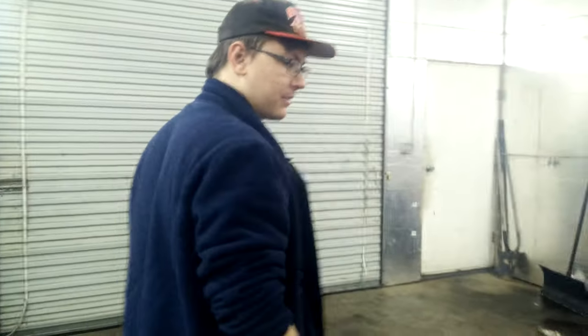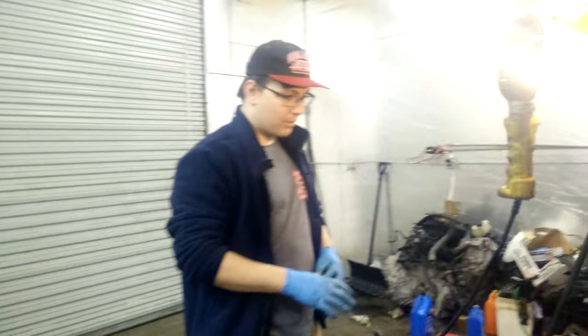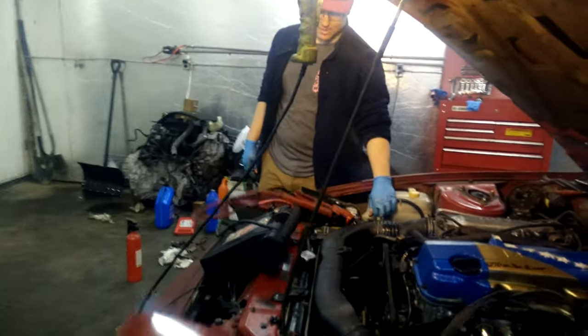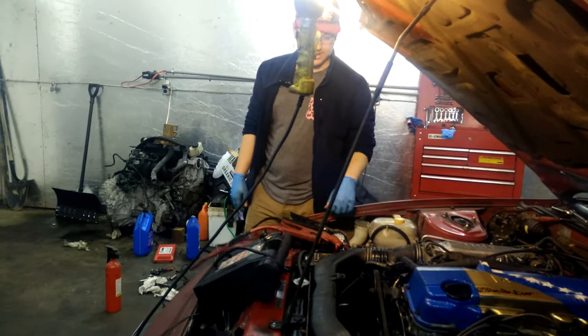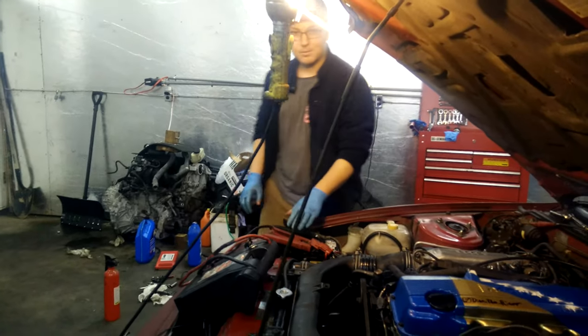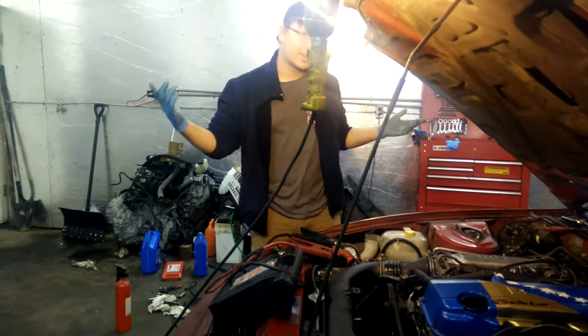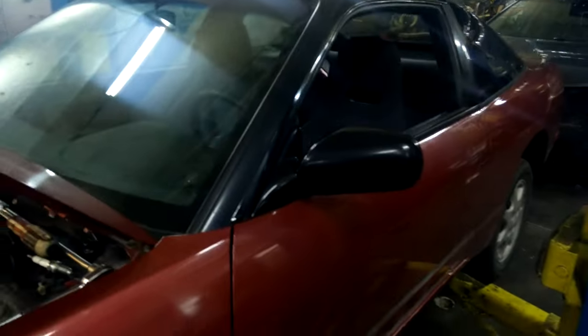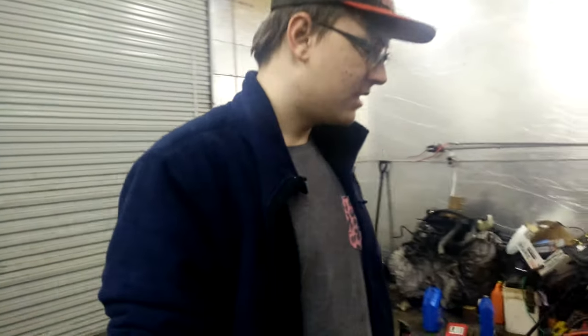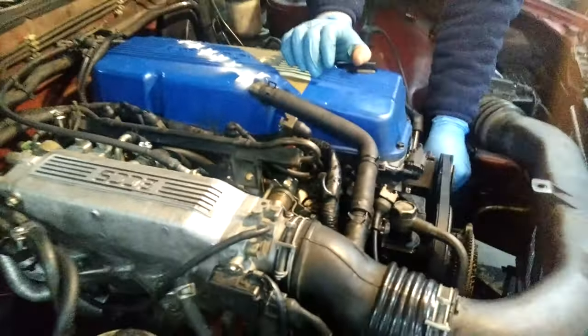We tested the ground for the fuel injectors too — I put a multimeter on the fuel injectors, cranked it a little bit, they had good connection, they had 12 volts. Also a quirk I noticed: I hit the fuse box and the headlights go up. I always wondered why hitting bumps made the headlights go up — now I know. Maybe I have wiring problems? Maybe that's related to the fuel injectors. Something with the wiring.